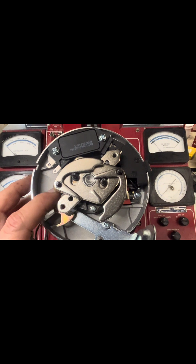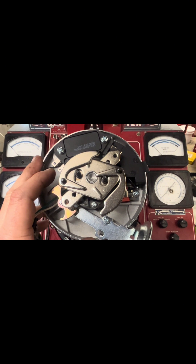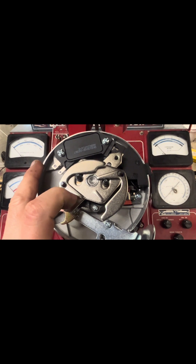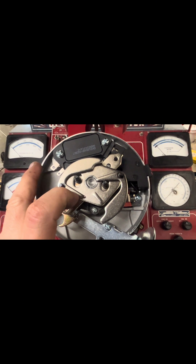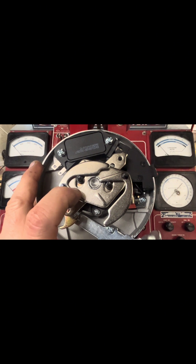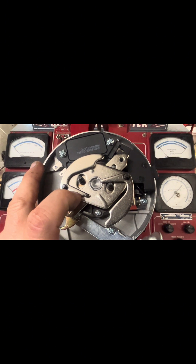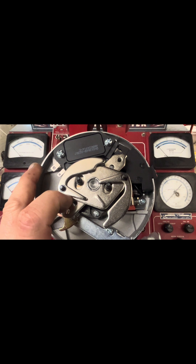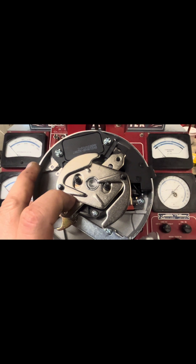I've taken this apart — I'm free-handing it so it may be a little wobbly — but this looks like a regular unit patterned after the original HEI. There's really no ability to limit the advance in here short of welding these slots up, because there are no bushings in that little bag of tricks to limit it. So I'm going to take this distributor apart and weld up those gaps to get it to the client's spec of 22 degrees of mechanical. To do that you have to take the shaft apart.